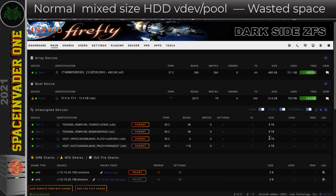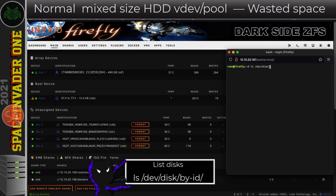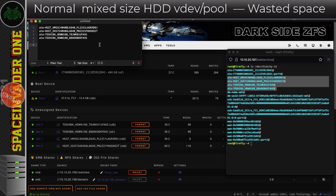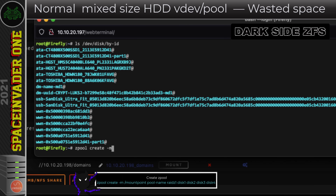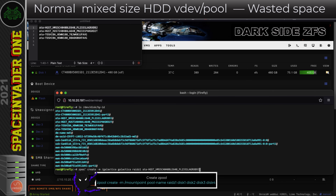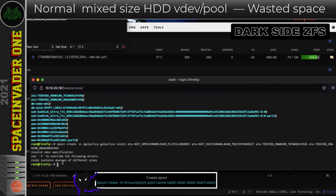On this server I've got four hard drives — two 8TB and two 4TB. Let's see the problems that happen when we try to make a RAID-Z1 pool from these mixed size drives. First I'm going to find the disk IDs by typing `ls /dev/disk/by-id`. We've got two Toshiba drives and two HGST drives. I'll copy the IDs into a text file, then create a RAID-Z1 pool by typing `zpool create -m /galactica galactica raidz1` followed by each of the four disk IDs.